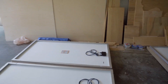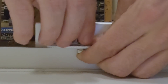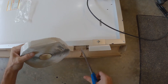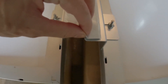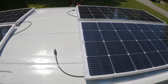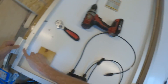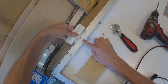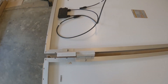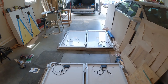Lay your panels out the way they'll be on the roof. Install the Z brackets over the holes on the sides using the screws: put the washer on the bolt, the bolt on the Z bracket, then the lock washer and nut, and tighten it all down. Get your Dicor butyl tape on the bottom of each Z bracket so you can slide it around on the top of the van without damaging the metal or paint — keep the film on for now. Clean and wipe your entire roof before putting any panels up top. Mine needed adjustments: the two front sides had to be moved back to sit on flat ground, and the middle brackets had to be in a zigzag pattern because the van wasn't wide enough side to side.